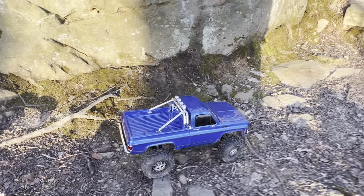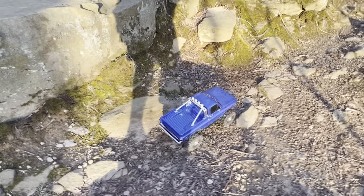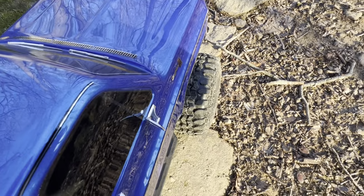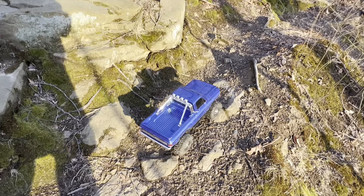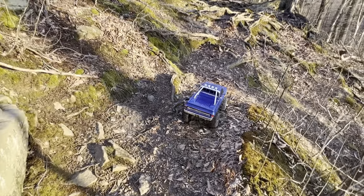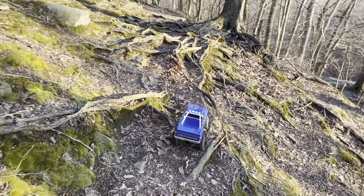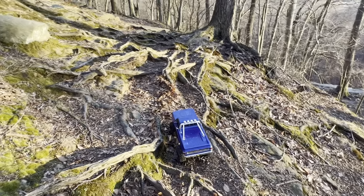My previous video - the Devil Staircase - really bugs me, I can't get up that thing. I feel like I should be able to. It's right at that angle where you're lightening up the fronts and it just won't bite - you've got all the weight on the rears and you just won't go up. It's not tipping over backwards, it's just sitting there gripping and slipping. I've got a little idea - I'm going to modify these tires that are currently Ohio cut with traction bars cut out of them. I'm not going to do a full Tennessee cut but I'll sip the lugs and cut a couple little lugs out in the center patch to make like a mini traction bar - going in stages.